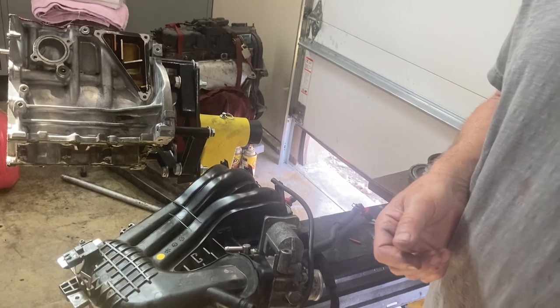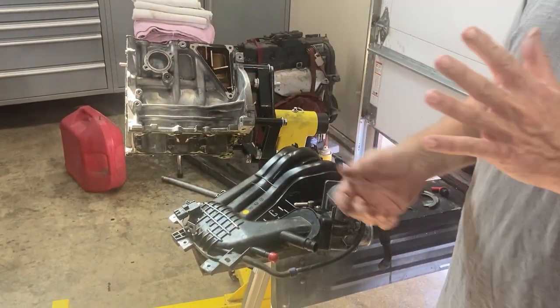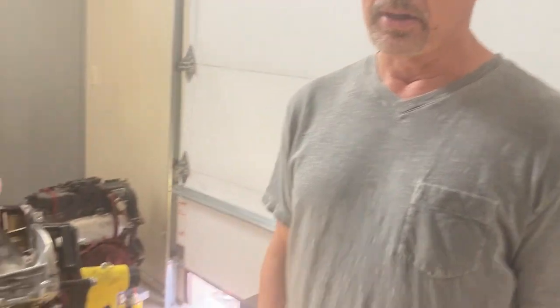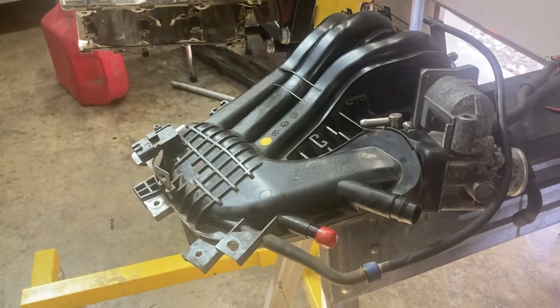I'd be willing to bet this car never had a blown head gasket. I'd bet it was always the PCV valve and the previous owner just assumed it was a head gasket - look at the mess he got himself into. He could have just put in a thirty-dollar PCV valve and been driving down the highway, because these are pretty good engines. Do they blow head gaskets? Yeah, usually because they overheat. But he just made the assumption rather than doing that quick little test of unplugging it to see if the smoke goes away.